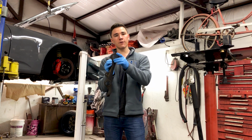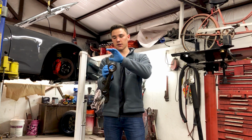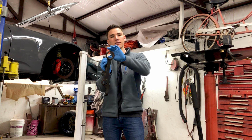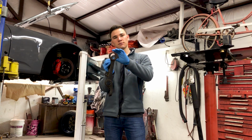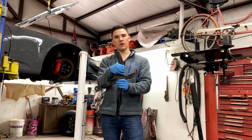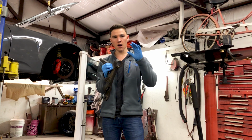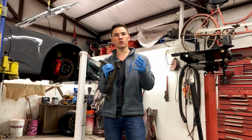this one's actually very difficult to get to, just because normally the control arm or the lower compliance bushing sits right here. Well, to get this to mount up is very, very difficult on the press. So I might have done a little bit of maneuvering and might have, well, it kind of explains itself at this point. So the passenger side is kind of on hold, so I had to go ahead and order a new lower control arm.